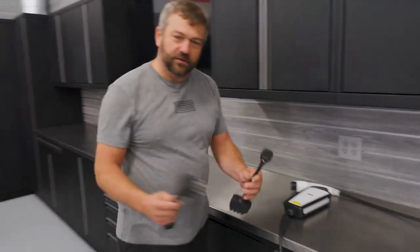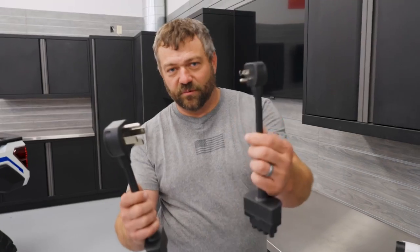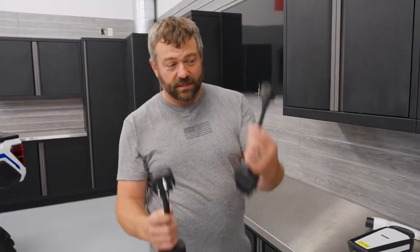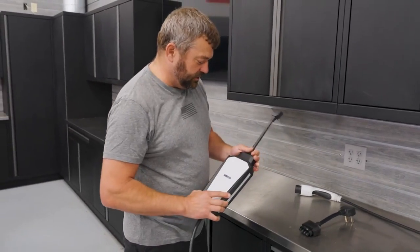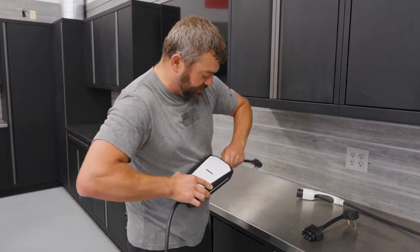Come on back and follow me to the wall so we can see where power starts getting into this Ranger. When you get a new vehicle, you actually get two of these adapters — one for 110, one for a 220/240 outlet depending on what you've got in your shop. Today we're going to be using the little guy so we'll get a slower charge rate, but it'll at least demonstrate since we're too far from the other outlet here.